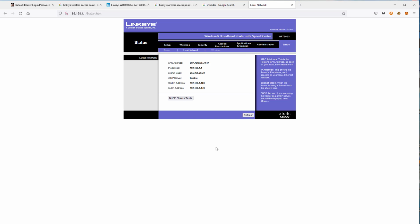All you need to do is plug your PC into that device, find your default gateway, access the web interface, and then set it up yourself. And then you don't have any of that stupid software, and it's configured the way you want it to. A lot of those only give you a stripped down version of setup. Like, hey, what's the starting IP address? What do you want to reset the name to? Okay, you're all done. Boom.